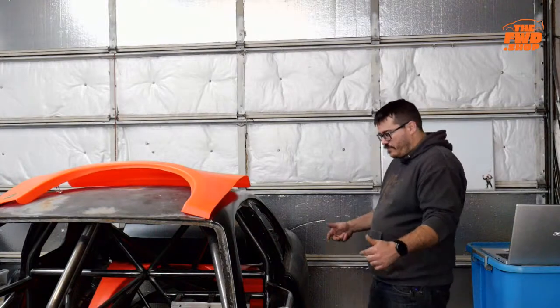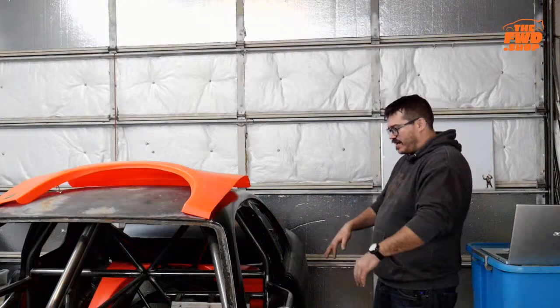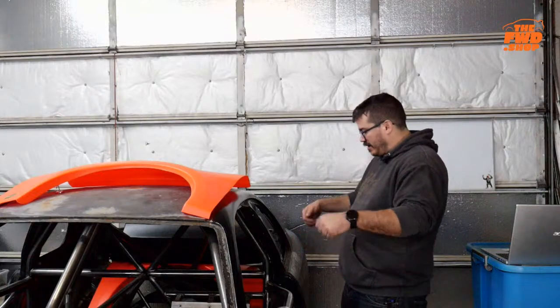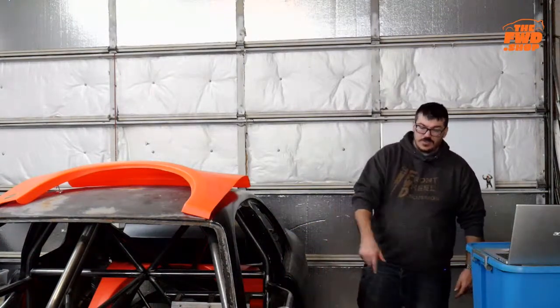By slowing down, taking a second, and going, hey, if I put these door bars in and flip them this way, they won't be in the way. The distance is the same. I can tack them in, and I can weld everything out, and I still have this giant hole in here. And then once everything's welded where it needs to be, I can crack those tacks off and pull those pieces out, and I still have this giant door opening, and then I can put those in last.